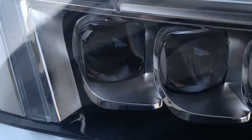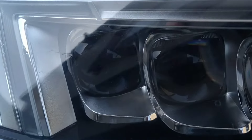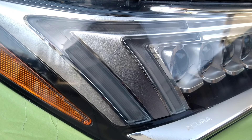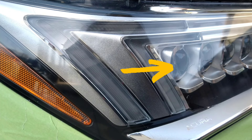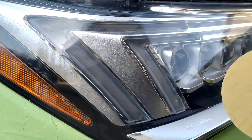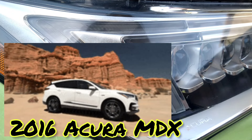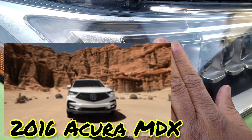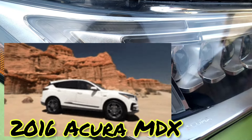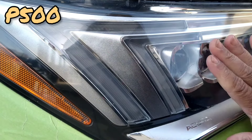What I generally try to do is apply a thicker coat at the top where the headlight is prone to go bad, and I just got a little carried away. You have to know when to stop. But sometimes, especially when transitioning from summer to winter or fall, a couple of seconds and a couple of degrees make a lot of difference when you're spraying the coating — especially doing a heavy coat instead of two coats, which is preferable.